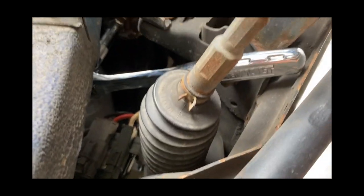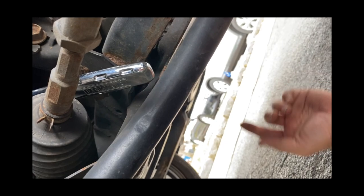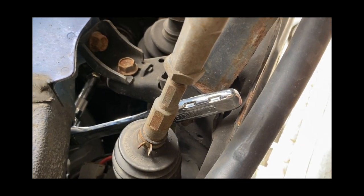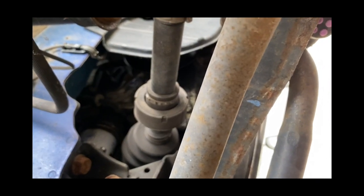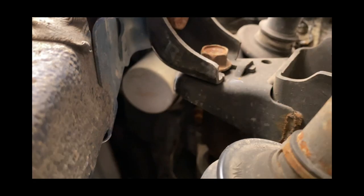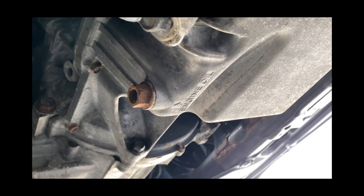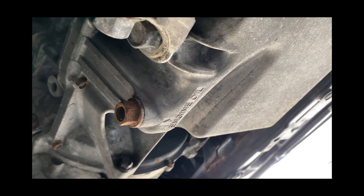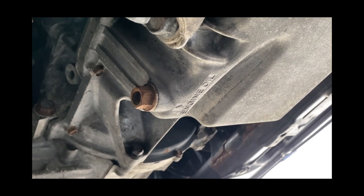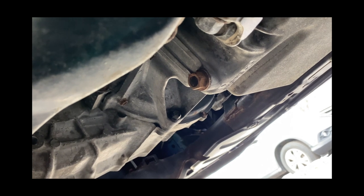There's not much room to work here, so I'm slowly twisting the filter off. I'm going to grab my oil pan so when I have this off and it starts leaking, it goes in the pan and not on my driveway. I've got the oil filter loose — now that it's loose I can spin it off by hand. I'm going to leave that for now and go remove the engine oil drain plug, because you don't want to remove either of these if the other one is seized — you'd have no oil and no way to move the car.